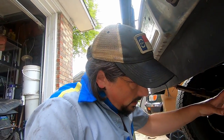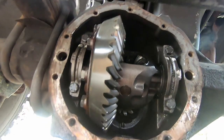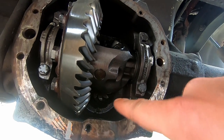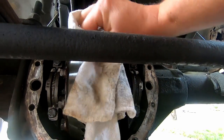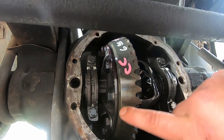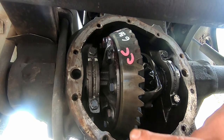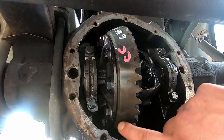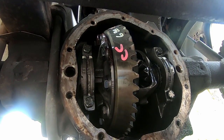Another question I hear all the time: how do I know which gear ratio I've got in my axles? Well, if you're sealing up a cover like this and changing the oil, now's a good time to find out. What you can do when you've got it apart - you see the pinion way back there - if you count the teeth on it and then count the teeth on your ring gear and divide the two, that'll give you your actual ratio. A lot of times you don't have to do a whole lot of counting, because sometimes stamped on the outside of the ring gear it'll say something like 41-10. You divide those numbers: 41 divided by 10 gives you 4.10. If it's not stamped, then you do have to count. Turn the ring gear all the way around and look for that stamping.